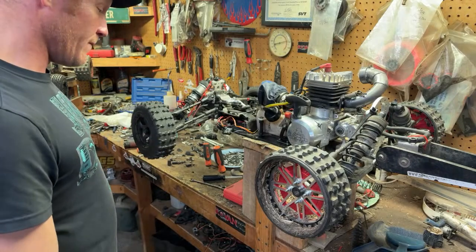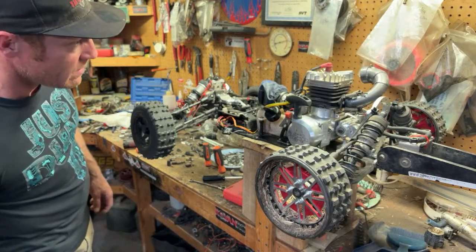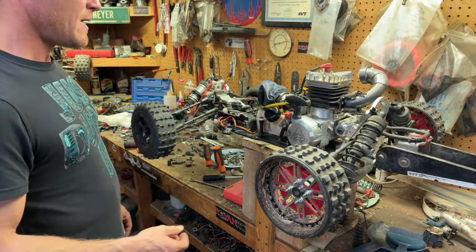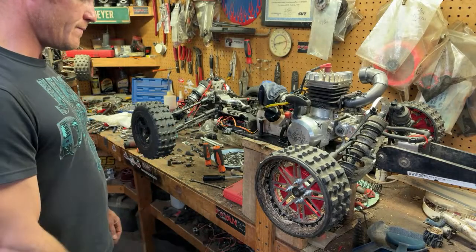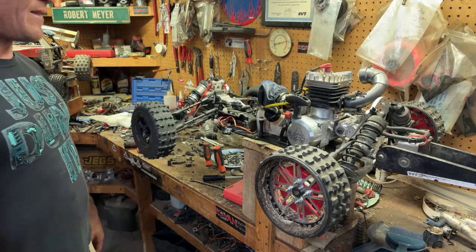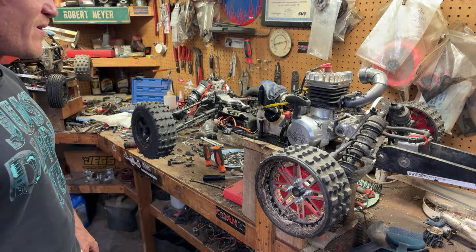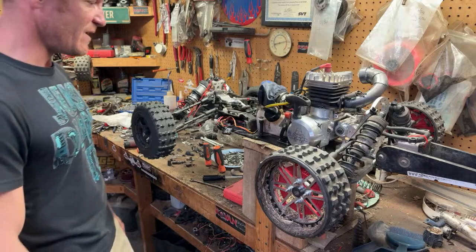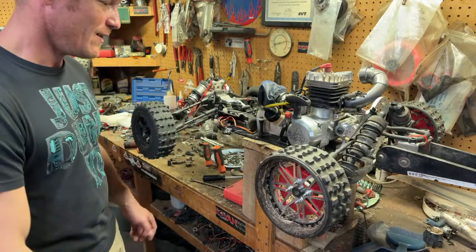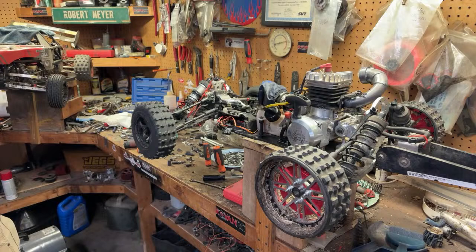Because like I said, this was my third runaway. I'm pretty sure I had one with the Rampage, but that one was different because it had to do with throttle linkage. My throttle linkage wasn't set right, and luckily it tipped over. It wasn't a CY, it was an HY, a 30.5 cc engine. No big deal. It wasn't a $2,700 big bore Taylor RC engine.